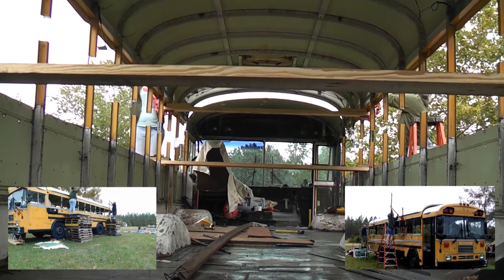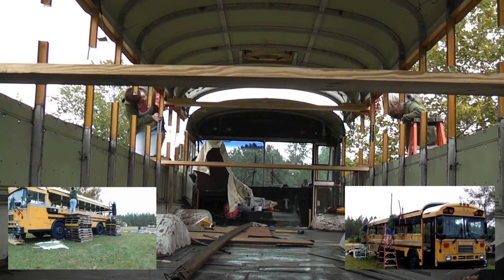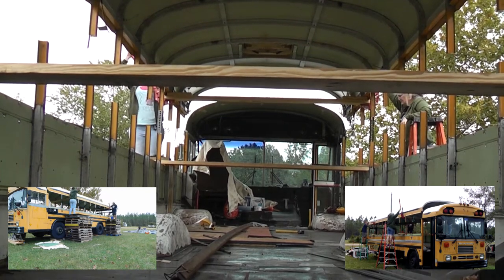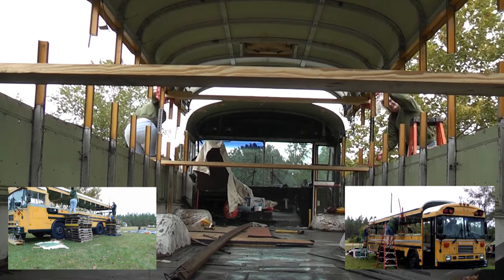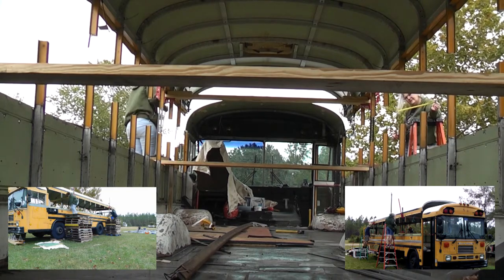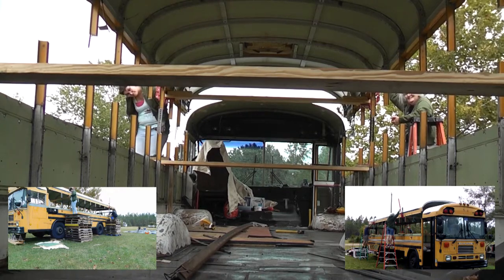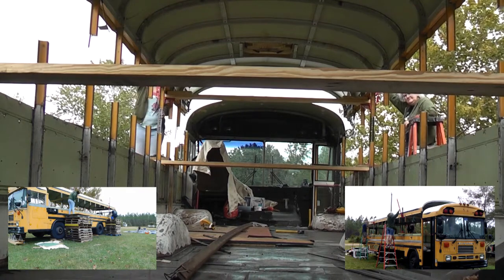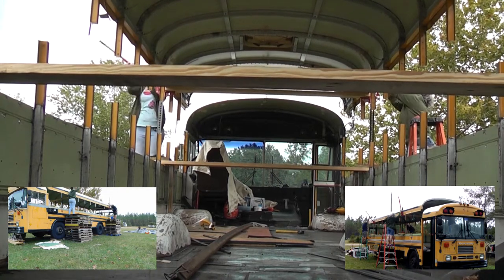We got it up there, and at some point in this, you may get a chance to see, we had to stop and then realign it. So if you have the type that has that black part that's adjustable on top, make sure that you go ahead and just turn it straight up. We almost didn't catch it because we were so focused on looking down. As you can see, we raise a few links, and then we pause, and all four of us had a measuring tape. We would tell each other what our measurement was, and if we had to adjust one, we did that. So we had four different measuring tapes, one at each station. We took our time and did it right. You want to make sure everybody's safe.